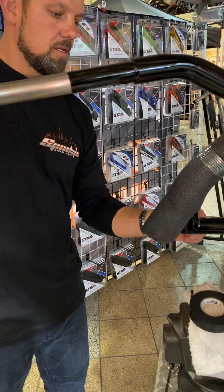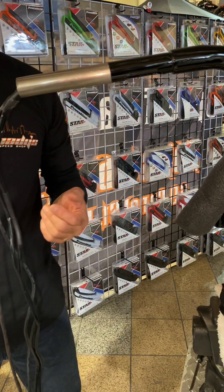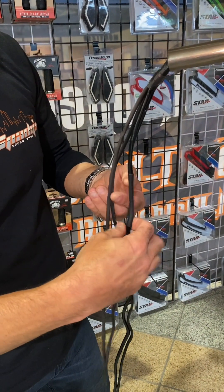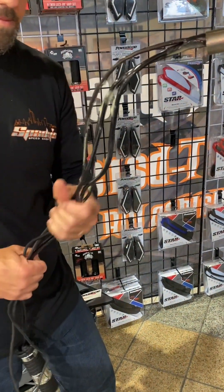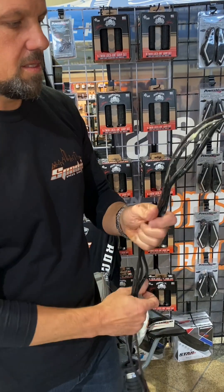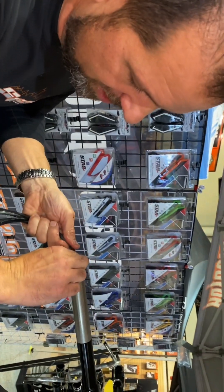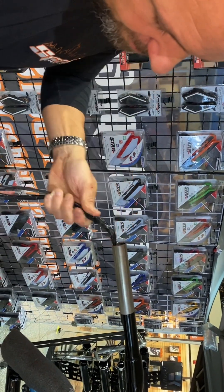The good thing is with my 12 and a half inch POV Twisted T-Bar, you do not have to extend the Harley heated grip when you're fishing the wires through. I like to keep the wires organized like I said in the other video, so I'm going to coat all these guys with lube, keeping all the wires separate. A cool little trick too is if you want to make things easier, put a little roundness on the head of this wire harness. It will make it nice and easy when it comes down and goes into that first turn.